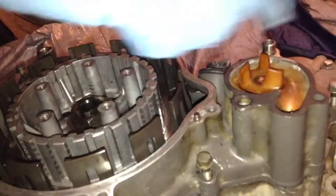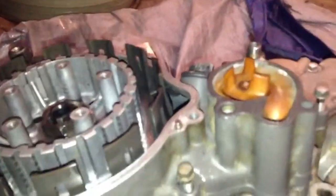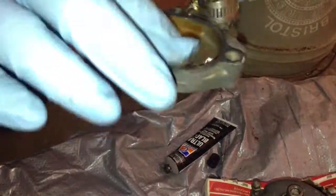And you want to be careful around here because obviously you've got water flowing through. As long as you let this cure, it'll be fine, but you don't want to have raw RTV running around with your water. Stop any leaks you have. It stopped all the water. And same thing to here. And the reason why we're putting this on too is because there's a bolt that goes through that holds the case on as well as this, so may as well get them all done at once.